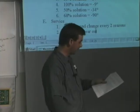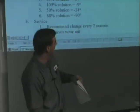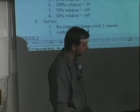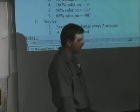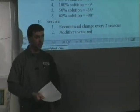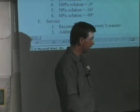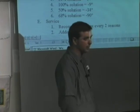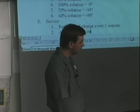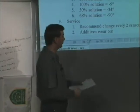You probably should put some acid flush in and run it, because your cylinder walls are probably looking like this. I think it's in this packet — it tells you the thickness of calcium or lime buildup and gives a number for how much it changes the temperature. It's a pretty significant change with just a millimeter of debris. So if you have a lot of buildup in your engine, it will actually cause your cylinder liners and your engine to overheat, even with plenty of antifreeze in there.